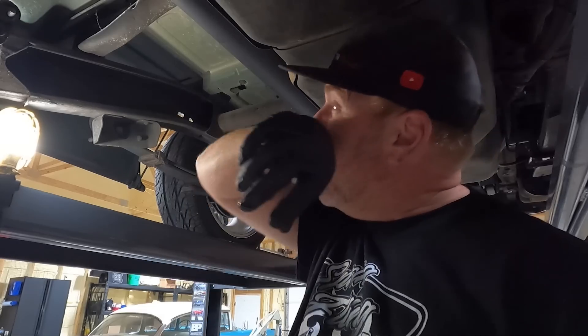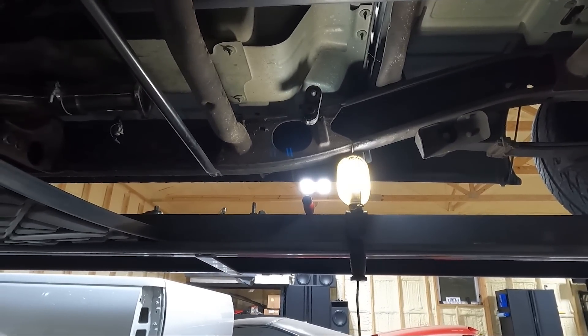The joys of a lowered truck! Let's go grab our new intermediate pipe and thread it up to the front over the middle cross member. That area right there — we're going to move it up over the cross member and see what we need as far as putting it on. I'm going to need some new bolts. I'm also looking for any marks on the heat shield, and I'm going to take this heat shield off while we've got this all apart — the muffler sets up here, there doesn't even need to be a heat shield here.